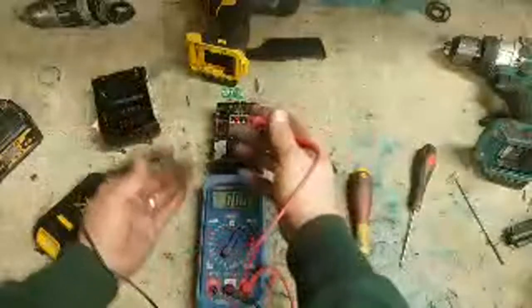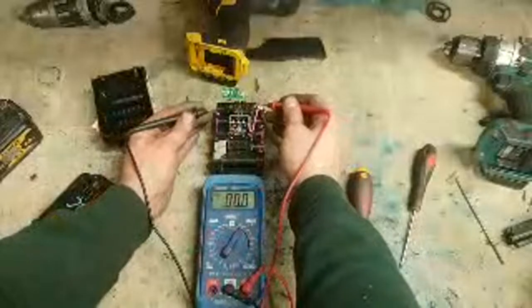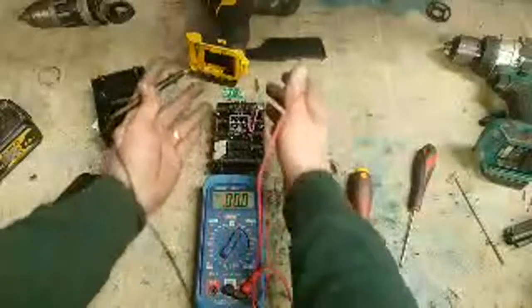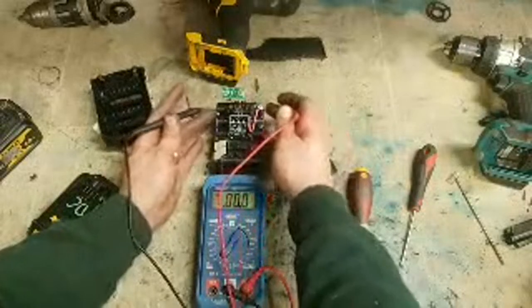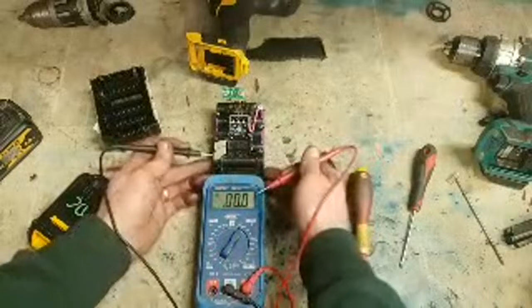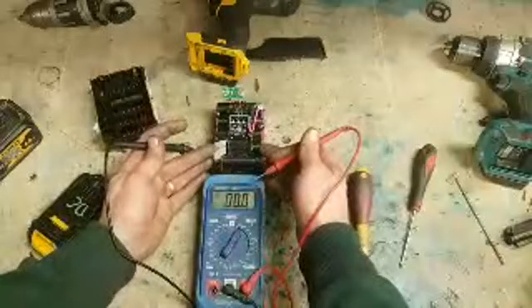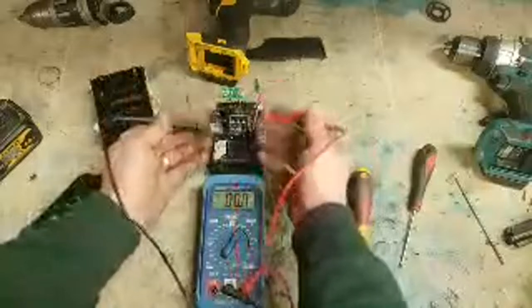So this one here, you're to boost it now. Stick your battery onto it. Start putting 20 volts onto it. You're assuming these are all working, you're assuming they're all under voltage at like 3 volts. What you're actually doing is you're putting extra volts into these three cells. This first one's 0. They're dead. They're not taking any voltage. You stick it in the charger, it realizes that straight away. If I stick this in the IMAX charger now, start charging, that comes up straight away. Something's seriously not right. Won't charge it for me.